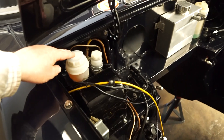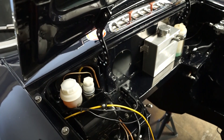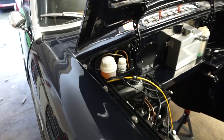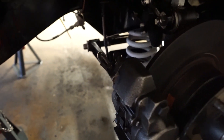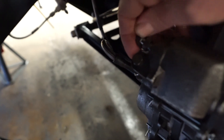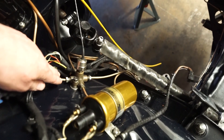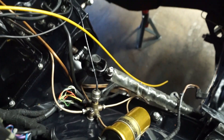Just before we get started, that's the master cylinder reservoir on my car. If you've got a metal cylinder you can still use the Gunson's system — you just get different caps depending on the master cylinder you have — so we'll be removing this and connecting the system up to it. The bleed nipples are on the brakes, so if I turn the wheel to the side you can see the one on the front brake — it's got a little cap on it, and that's the bleed nipple underneath. The braking system on these early MGBs is fairly straightforward: a single line runs out of the master cylinder down to a splitter, with two lines feeding the front brakes and a single line going to the rear that's then split over the rear axle.